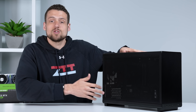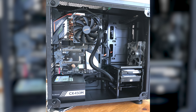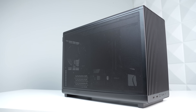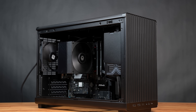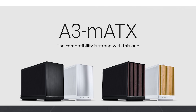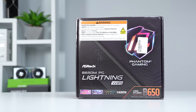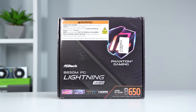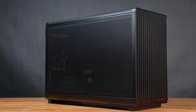The only component left is the case, and since we don't have a GPU I wanted to choose an option that hides that decision. I went with the Lian Li A3 — there's no glass side panel so most people won't notice there's no graphics card, but it's big enough that if you ever do add a GPU you can fit almost anything. This is my third time using the A3, and it rocks a smaller almost-ITX form factor while still being micro ATX. Micro ATX motherboards are way cheaper than ITX, and full-sized ATX power supplies are cheaper than SFX, so it's a perfect combination if you want a smaller build without paying the ITX tax.